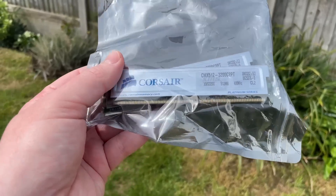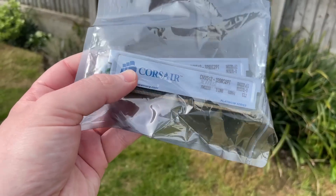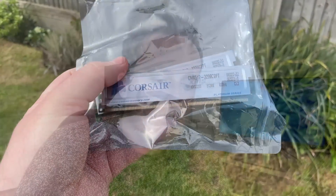Let me give you the synopsis and timeline of the issues as described in the letter. The suspected problem is the motherboard, but there is quite the long list of potential problems that occurred during the time this PC was used. The PC would randomly not power on — they suspected a dodgy USB cable, as wiggling the cables would cause the PC to fire up. They recabled the PC with new power and DisplayPort cables, replaced USB cables, and removed a lot of old cables, and the PC started to work.